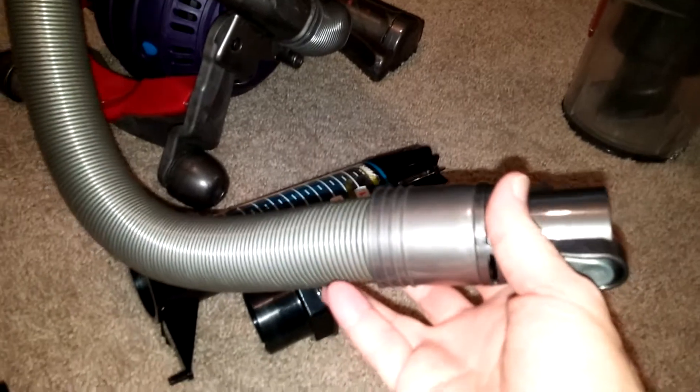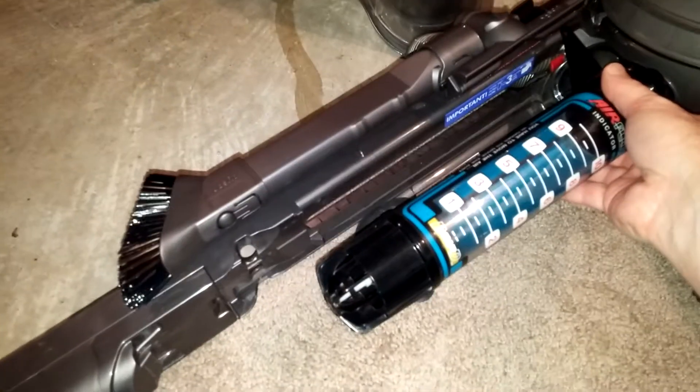I hope this helps. Have fun measuring. But when you measure, everyone who uses a Baird meter — if you care about getting accurate measurements, keep your hoses straight and keep your Baird meter level. Don't tilt it. Literally move your vacuum so it's horizontal. With a DC40 similar to the DC65, I would tilt this over before I hook this up — I'd want it horizontal, not vertical.